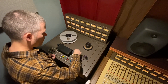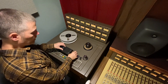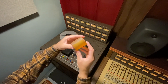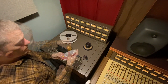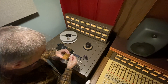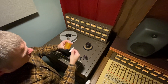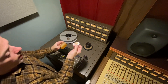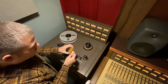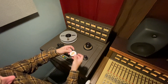I'm going to show you how I clean my pinch roller and the tape path. It does not look bad, but watch this. Let's take a little bit of this, just a tad bit — don't need much. Look at that. I use a lot of old original tape, so this is to be expected. We'll just let that dry for a second.